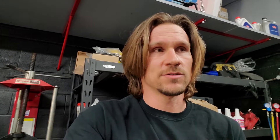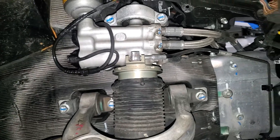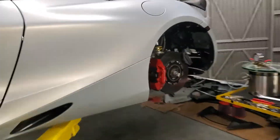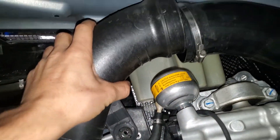What I would recommend you do is turn the car off, let it sit overnight, and start working on it the following morning. If you have a scan tool like the Autel, you can see some pressure values. These are the accumulators. For the fronts, you're going to have to remove the front wheel well liners. For the back, you have to remove the wheel well liners as well. Then just loosen this clamp right here and these three 8mm bolts, and you can wiggle this out of the way and get plenty of room for your wrench.